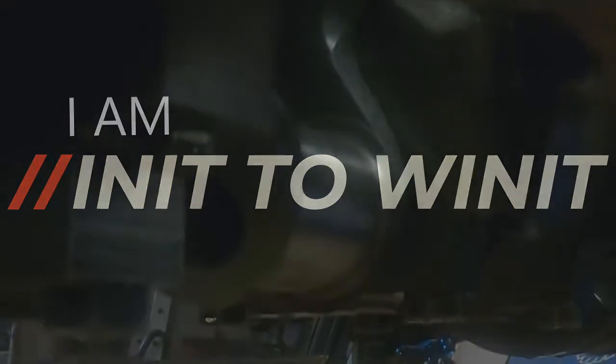As you can see, there's the webbing on it. It's really stiff. It's got some good main caps. These are all billet main caps that are up under here. This is a pure racing engine. As you can see right in this area, there's no provision for an oil filter here. All it has is an input for an external oil pump. It's already plumbed out for the external oil pump.